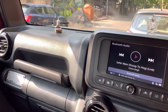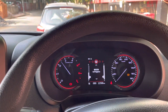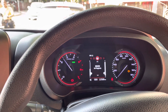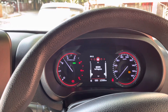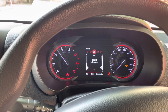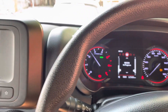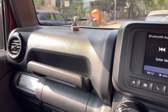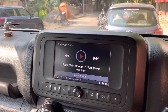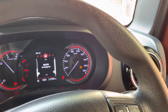On a long highway drive, engine RPMs tend to be around 1700 to 1800. The diesel Thar has a very lazy engine — it's overpowered for normal duties — and even at 100 km/h on the freeway you're only spinning the engine at about 1600 RPM. So even in normal highway driving, the regeneration function may not actually happen because the engine is still spinning too slowly and the exhaust gases are not hot enough to burn off the particles in the DPF.